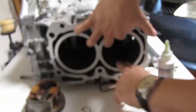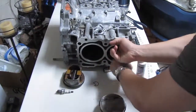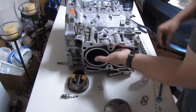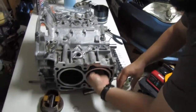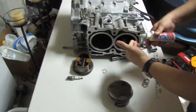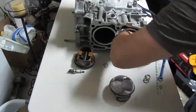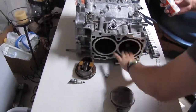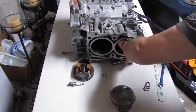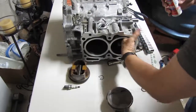We're going to use a gratuitous amount of lube and coat the walls of the cylinder — this is the last time we're gonna see it for a while, hopefully. This is Lucas brand assembly lube; everybody's got their own flavor. This stuff happens to be green, but the important part is it has a very high viscosity — it's a very sticky oil that stays put, unlike engine oil which just seeps everywhere.